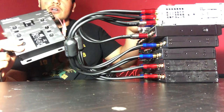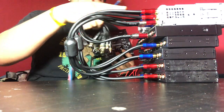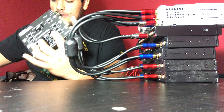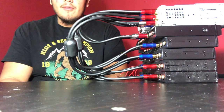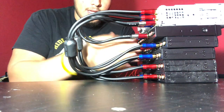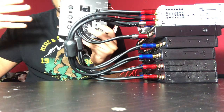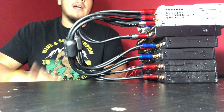So the full signal chain is: radio to equalizer, from the equalizers out through the Medusa, through the Medusa to your crossover, out of the crossover to your amps. Connect your speaker wires to your speakers and you have music. Tune it however you like and that's really it. To recap: output from the radio, input to the equalizers, Medusa RCAs all the way through, into the crossover, out of the crossover to your amps. Hopefully that's clear — go in the comments and I'll answer any questions.